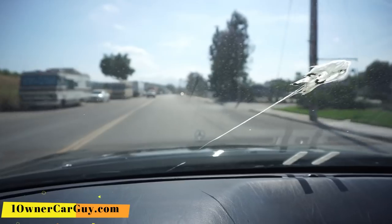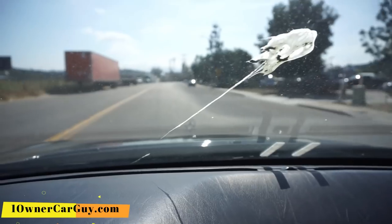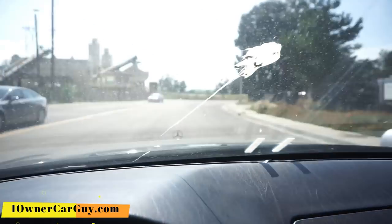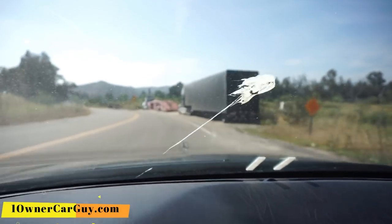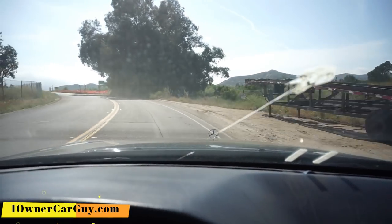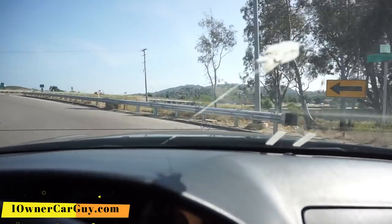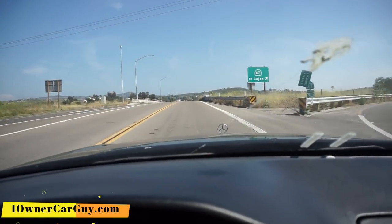It doesn't want to shift out of that gear. I just want everybody to know that's the way it drives. I never would fix stuff like this before I sell it, because then you don't get the warranty, and that's very important — with a transmission, which would be the weakest link on this car. There's 45 and it is not shifting. I'm going to try and downshift. It's going to run 3,500 RPMs. I'm running at pretty heavy RPM hoping it would pop and switch. That's why I think a filter and fluid may do something — flush, all that good stuff. It's just been sitting so long and these test drives are the most I've done with it.